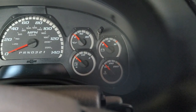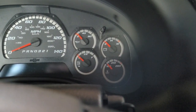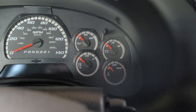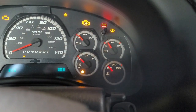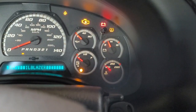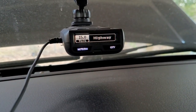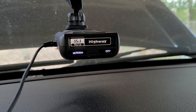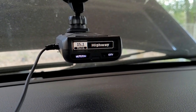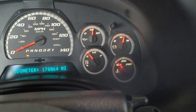I've got a 2007 Chevy Trailblazer and I'm having an issue with the voltage spiking up to about 15 to 15.2 when I first crank it up. It's been doing it for a year or two. It spikes way up above where it should be — it shouldn't go to 15, it should stay around 14. After it's been running a while it'll drop down to 14 or 13, where it should be, but it shouldn't be spiking like that.